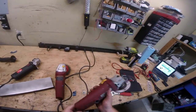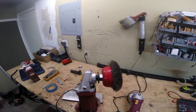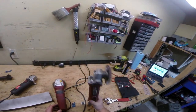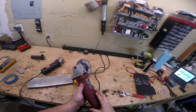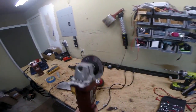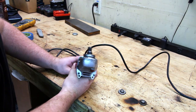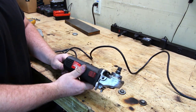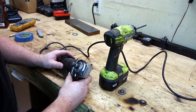To me, this is a really high quality tool — I actually like this one a lot. When this older unit died I went to buy another professional series one and ended up with the newer one, and I am definitely much less happy about that. In terms of review, this older one is an excellent angle grinder. If you can find these somewhere with metal vent fins, side-accessible brushes, and the top button, I would gladly pay another 20 bucks for another one. Now I was going to run the burnt-up unit until you could hear the bearing chatter, but I'll just take it apart and find that bearing.